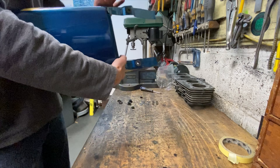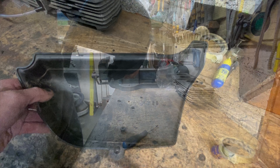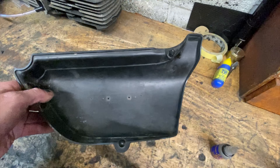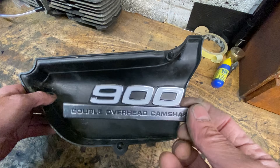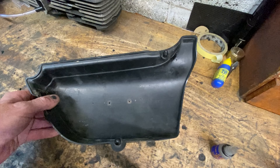The rear fin is a standard assembly so all I had to do is put in some grommets and some steel spacers — they just literally slip straight in. The grommets are made in two pieces with some tapered washers: pop it up from underneath, put the top rubber washer on the correct way until it snaps down, then push the little bit of tube in the centre. You do this four times to complete the fin.